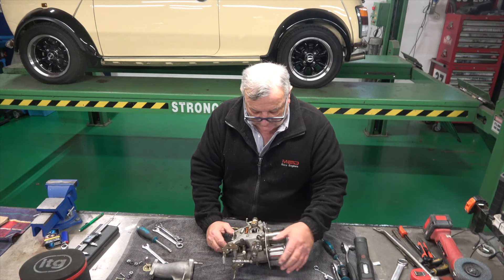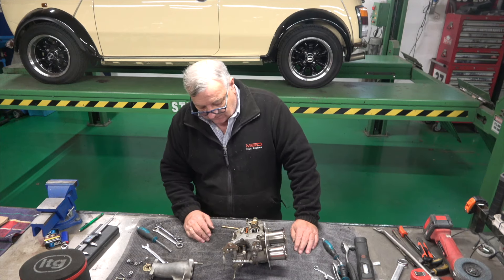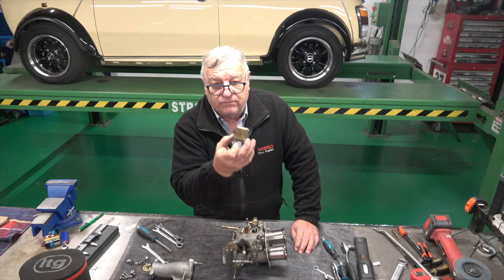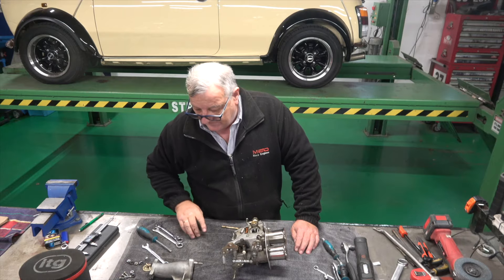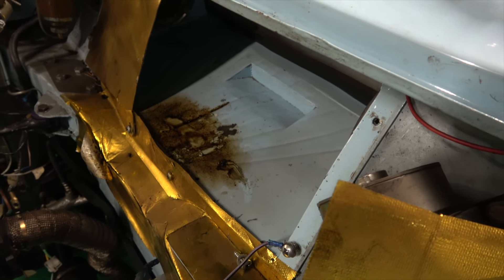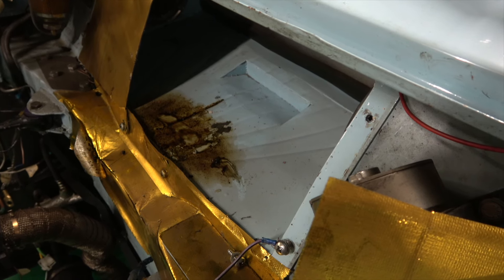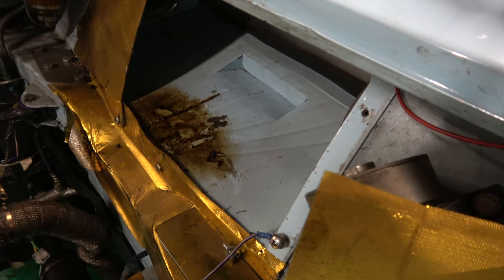It's worn, or it's been vibrating and damaged. And the only other thing is the bottom of this, where it's obviously been overflowing — you can see where the oil is on it. I'll show you in the car as well. There's quite a sticky mess underneath there. It's been overflowing and then with the heat from the exhaust, it's got a bit gummy in there.